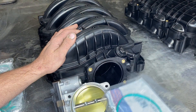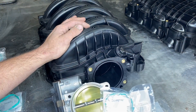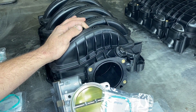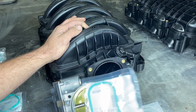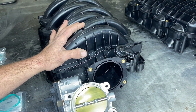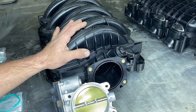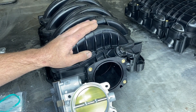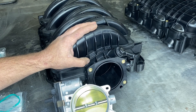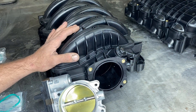The 6.2 throttle body gasket is a little larger than the 5.3, so make sure to pick one up. You can reuse your intake manifold gaskets, but since we're working on a high-mileage motor I'm opting to buy brand new ones. Later in this video we'll go over how to properly remove the old intake and bolt on the L86. We're doing the L86 on this truck because the motor is stock and we don't have any camshafts to justify the LT2.